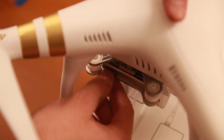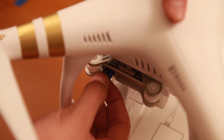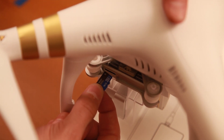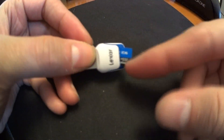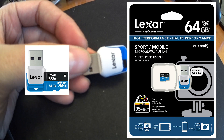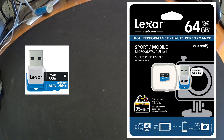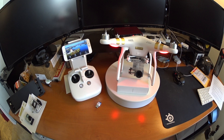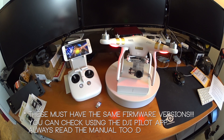Next, you're going to want to have your microSD card ready and format it as either FAT32 or EXFAT. If you just bought the microSD card or you're pulling it out of the Phantom 3 for the first time you should be good to go, but we're going to need a USB drive to get that data on there and install it into the remote later. If you have the Lexar card, Lexar sells little microUSB adapters that you can plug the microSD card in through a USB slot — they're USB 3.0 and super fast. It's really important that we do have some type of microSD card to USB adapter, because both the Phantom and the remote need to be updated in tandem, otherwise they run the risk of not being able to communicate with one another.